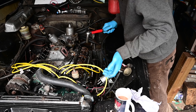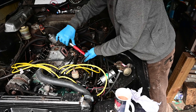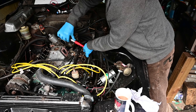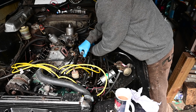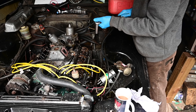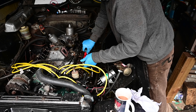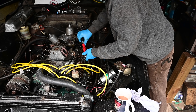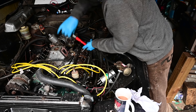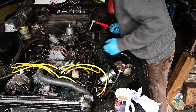Make sure the oilway is definitely 100% clear. You've got to torque this up to three then to eight Newton metres. I don't have a torque wrench that goes down to three, so I'm starting at five - which is less than finger tight by the feel of it. That feels like way too loose to be anywhere near right, and then - god, that's not tight at all, it's so loose. Done. That does not feel anywhere near tight enough.